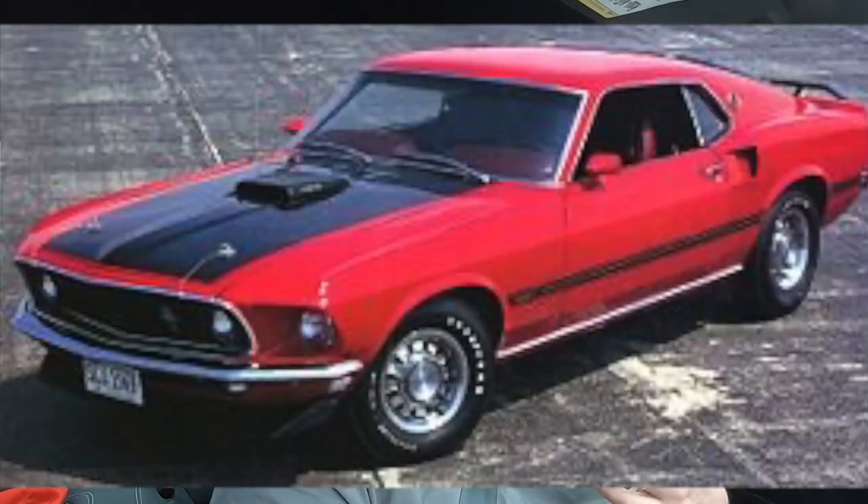What are some things I think they could have done differently? The first thing I would have liked to see is the Cobra Jet intake manifold on the car. If you remember back in 1969, you could get a Cobra Jet version of the Mach 1. I would have really liked to see them pay tribute to that by offering at least a factory option to order a Cobra Jet Mach 1 with the Cobra Jet intake manifold. Another thing I would have liked to see is using the Predator engine — the 5.2 cross-plane crank — and bump the compression up to 11-to-1 or 12-to-1, giving 500 plus horsepower.